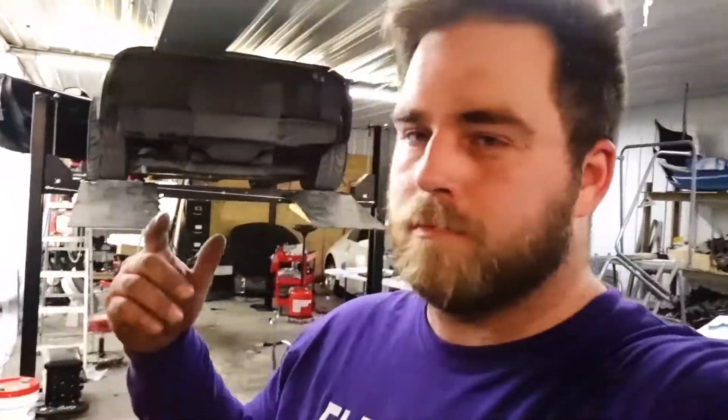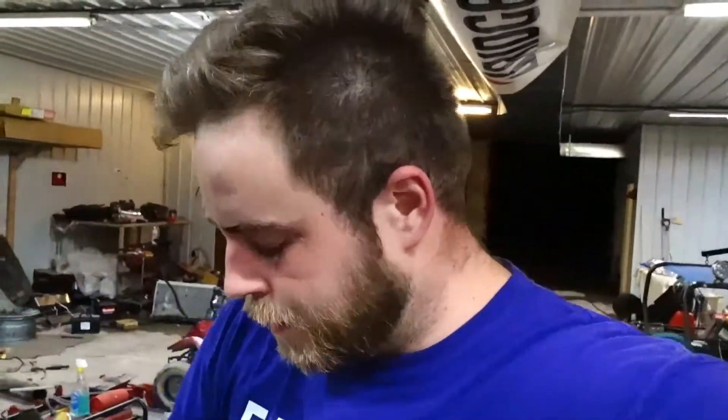That's working now. Got that ground into a bolt that goes to the subframe. The moral of the story today is: just because one fan's working doesn't mean they both are. I'm assuming that bottom fan probably hasn't worked since I've been on this car. So don't ever assume anything. If you're struggling with your cooling system, triple check everything — that's probably been a big part of my problem with this car overheating so badly this whole time, and I just had no idea because I thought it was good. It wasn't good. That's going to be it for today. Thanks for watching, don't forget to like and subscribe.